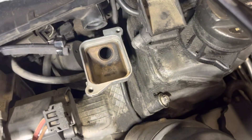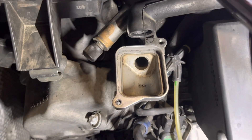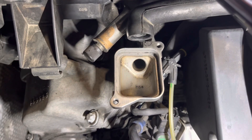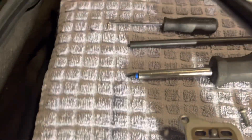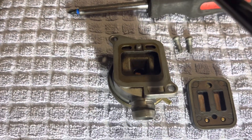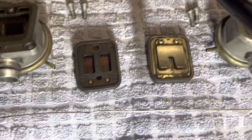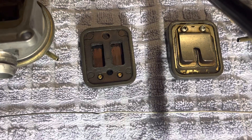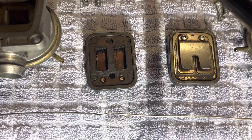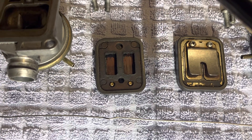I use this hose to blow through these ports. If you cannot blow through it, it's still clogged. Or if there's any resistance, continue to use the clean-out tool. And then if these reed flaps are stuck, I recommend throwing some WD-40 around the rubber pieces to help loosen the carbon. Then use this pick tool and gently go through the reed flaps, put it on the body of the assembly, and lift gently without trying to rip these rubber seals. And of course, just trust the old magnet to pick up these screws so you don't lose them.